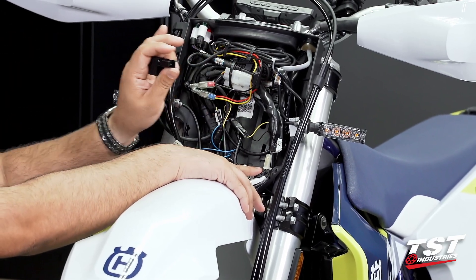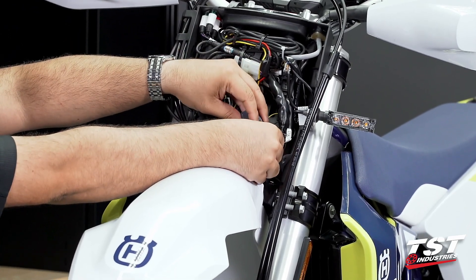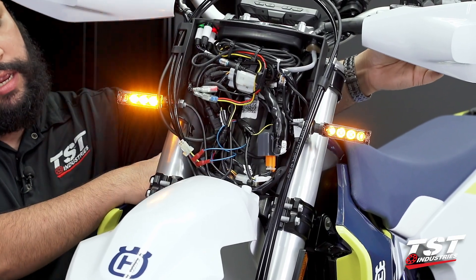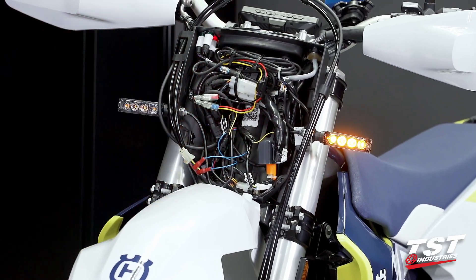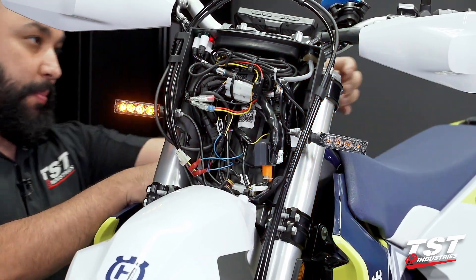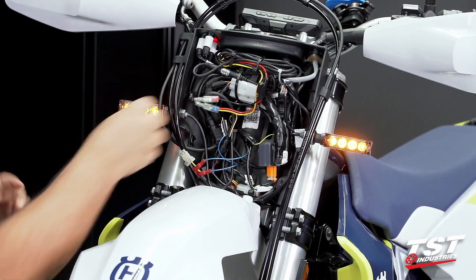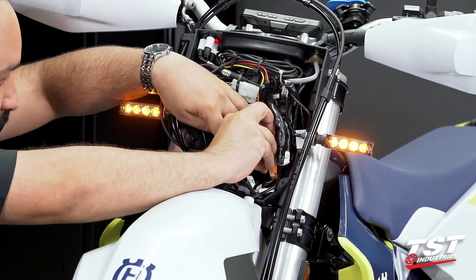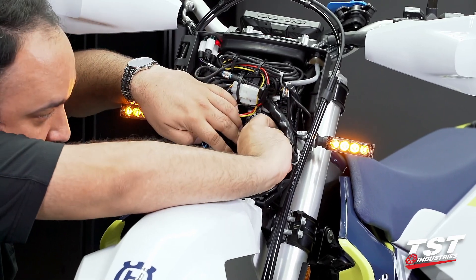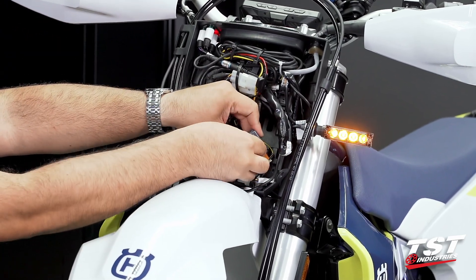We will gently press down on the locking tab and pry outward — press down on this and pull outward, freeing the relay. Then we can simply go ahead and reconnect our new relay. Just like that, you will now see that we have a correct flash rate; both signals will flash at the same 85 cycles per minute. Should you wish to adjust that flash rate you can do so. You can tuck the relay onto the post by bending outward on the mounting tab located behind the relay.